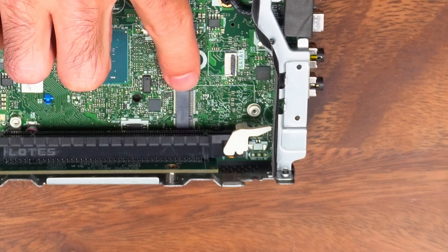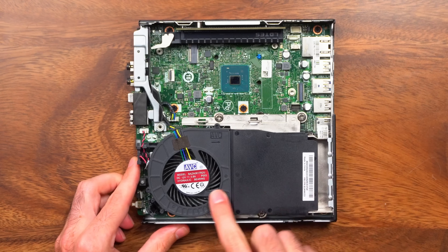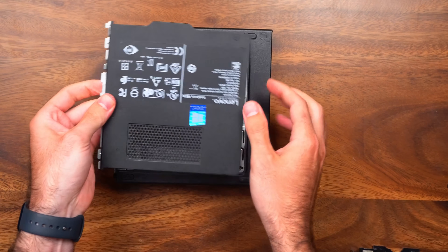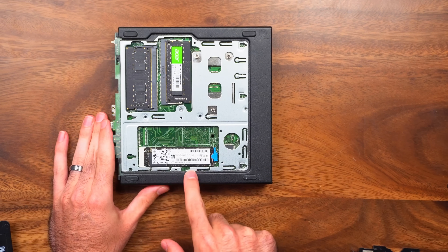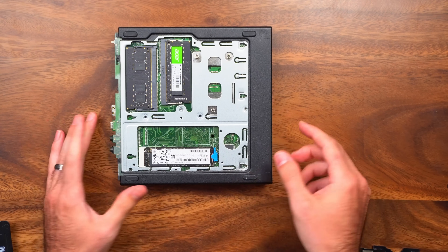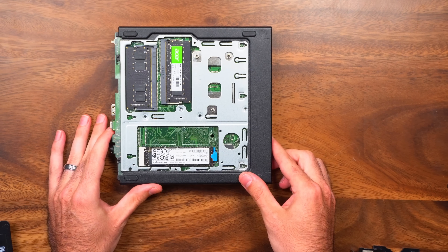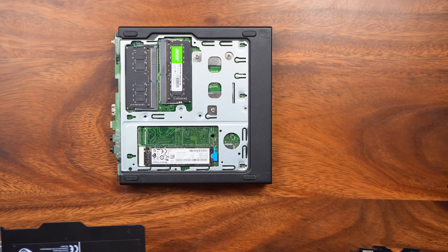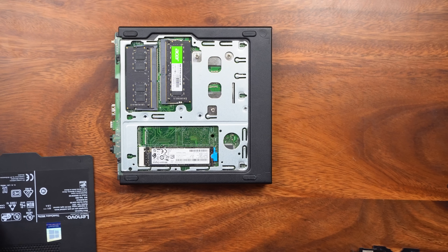You also have access to the Wi-Fi card slot if you want Wi-Fi, or to adapt it to another function. Then we have the cooling solution for the CPU, which is fine — kind of. I did run into some thermal issues, but I'll get to that in a bit. Flipping the device over from the back reveals the M.2 NVMe slot — it's obvious they're using the same motherboard design for different SKUs, because we can clearly see a second spot for another M.2 slot, but we just have one here.